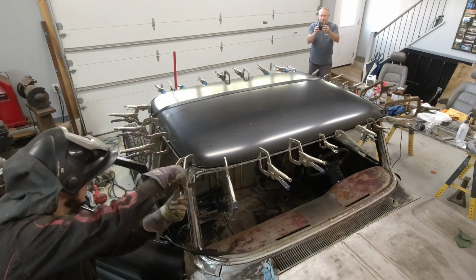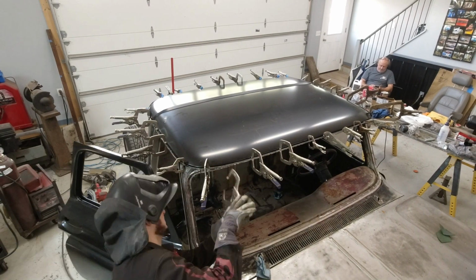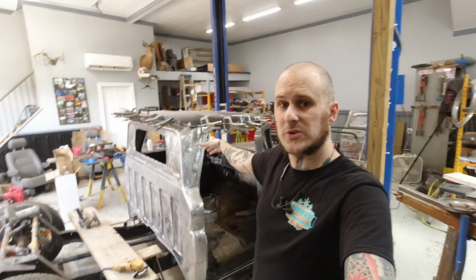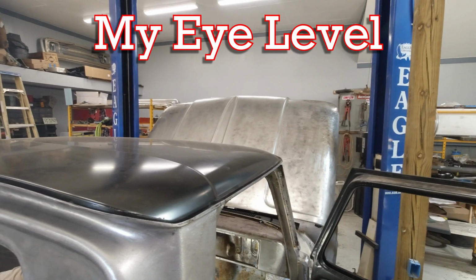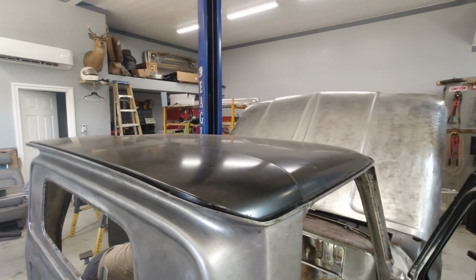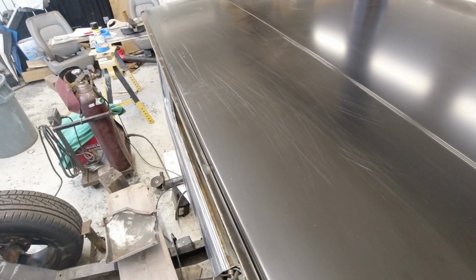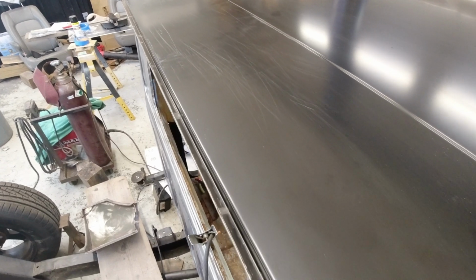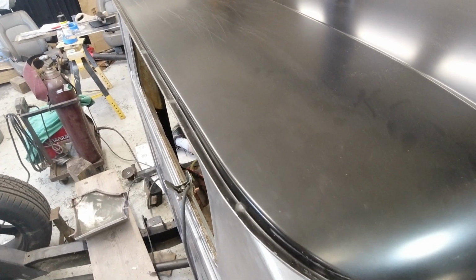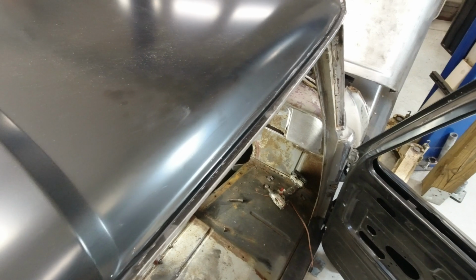The other reason that I wanted to do this is, yes, it made it more difficult. Having to weld up underneath of that flange on the existing metal meant that I'm fighting gravity with all of my spot welds. That's not ideal. There is a reason for that though. This truck, when it's sitting here, I'm 6 foot 1 inch tall, and I'm over top of this truck, and it's not fully laid out where it's sitting right now. So when this thing's at a car show, the average adult is going to be able to see over the roof of this thing. So I want the flange inside of that drip rail area to be as clean as we can get it. I don't want to have to get down in there and try and grind spot welds into that recessed little 3/8 inch wide lip. That's just not going to happen in a clean manner without digging into the base material. It's never going to be quite right. Welding up underneath into the metal gives me such a cleaner look on the top edge of this thing.